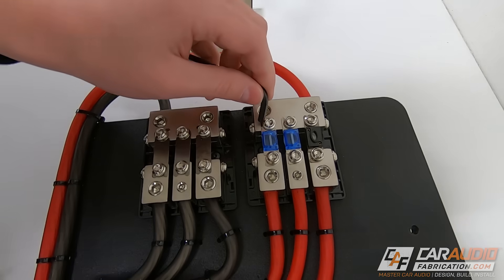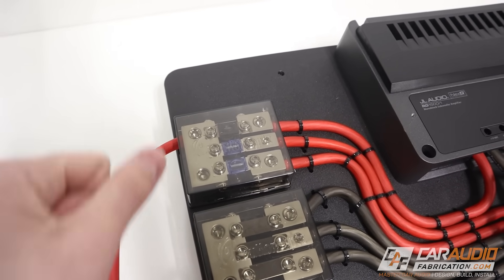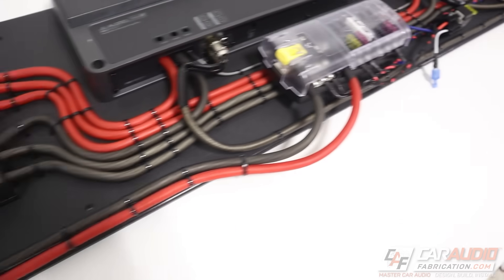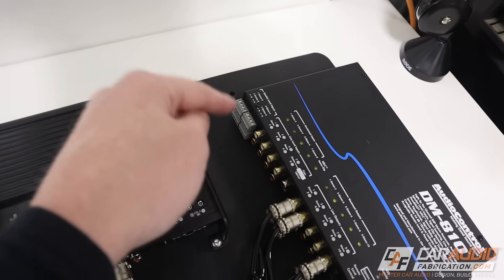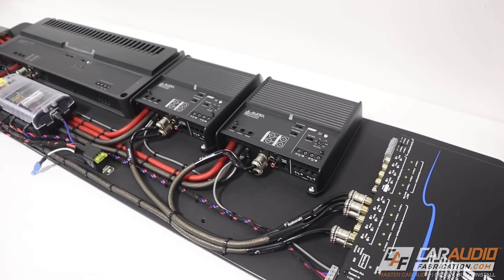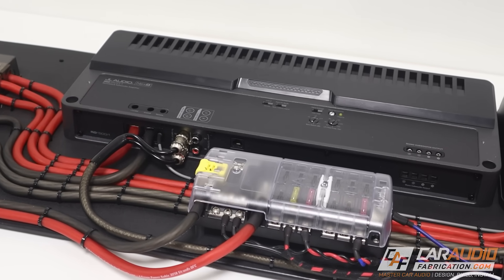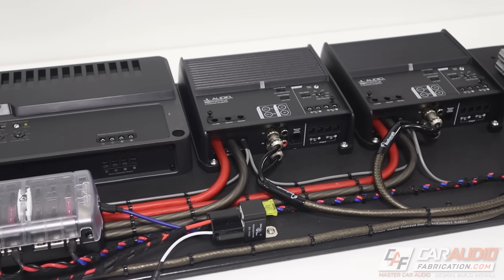I also connected all the fuses on the power side of the distribution. If you want to see a video about how I planned all the electrical and picked fuses, check out my electrical playlist. You also have the ground links attached to this block. The connections I'll still have to make in the vehicle are the power and ground connection to the battery, the remote turn-on lead from the head unit, and then I'll run the musical signal into the DSP. I've intentionally not connected the subwoofer or speaker wires yet, since I don't know exactly which way those will run in the vehicle — it'll be easy enough to connect them once the amp rack is in place.